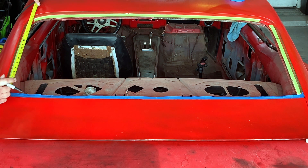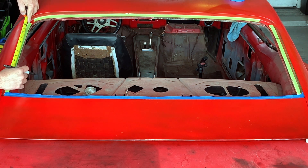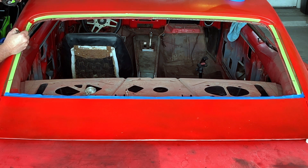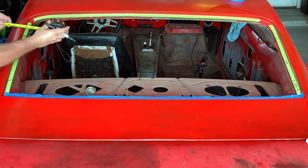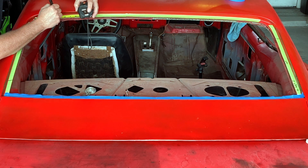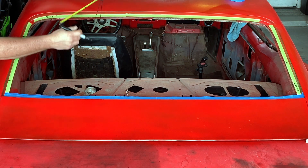Come in 3 and 3/4 inches — about right there — mark it, then come up 10 inches. It's not rocket science, guys, so just eyeball it in. Now we have our left and rights done. For the top, just for reference: 3.75 inches, then 10 inches. Starting on the top on the driver's side, the first pin is 3 and 3/4 inches, so we'll come over and measure out to about there. That first one goes right there. The next one is 6 inches from that.